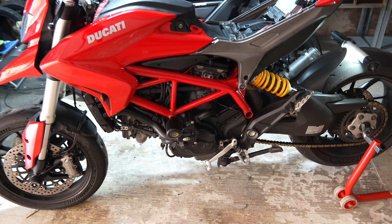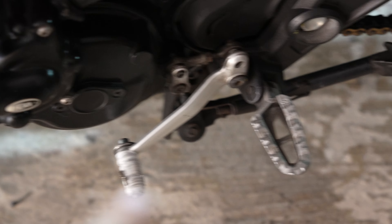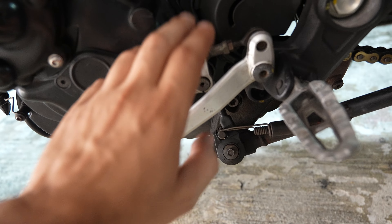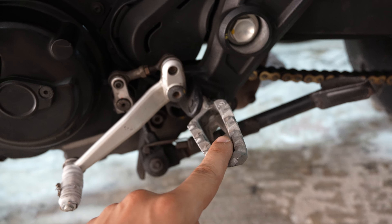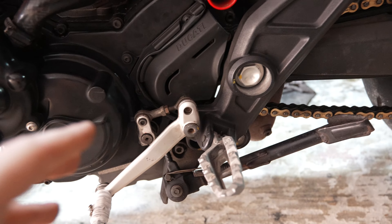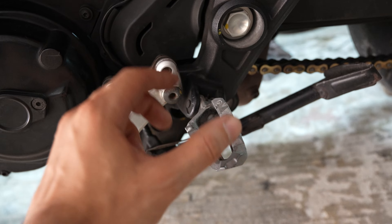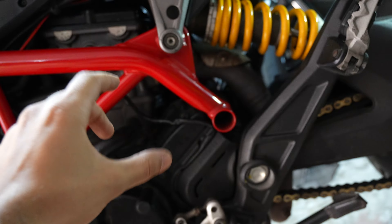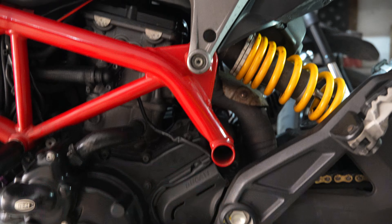The plan to fix these issues: I've already ordered some foot pegs and a gear lever — specifically an adjustable gear lever and adjustable foot pegs. I didn't order rear sets because that would be overkill; I just need a little more clearance on the foot pegs. The other thing we need to do is take the exhaust for repairs and welding — remove the heat shield and the three bolts connecting the manifold to the engine.